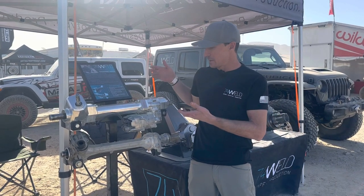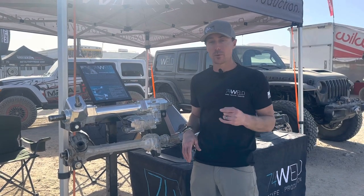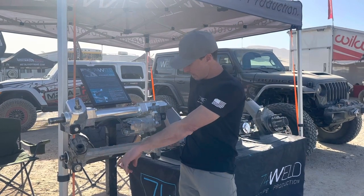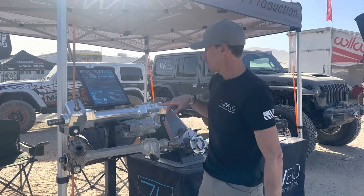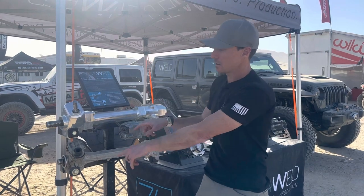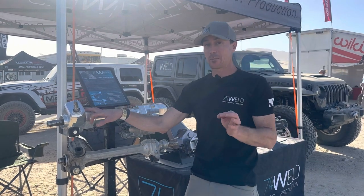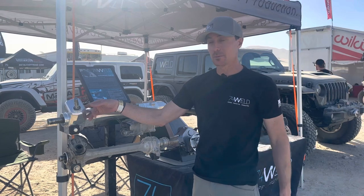So we developed this, which uses the Ford Performance 3.0 guts. We redesigned the housing. On this one you've got one point of contact on this side, basically a half point of contact over here. We changed the bushing setup — we do a two point contact here, two point contact here — and remove all the adjustment out of the rack and pinion. We set backlash ourselves with this 5-axis billet CNC piece.